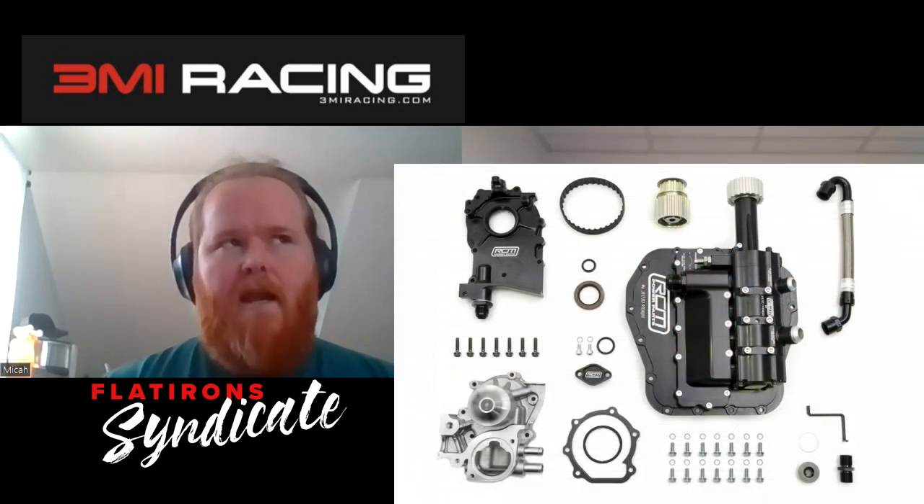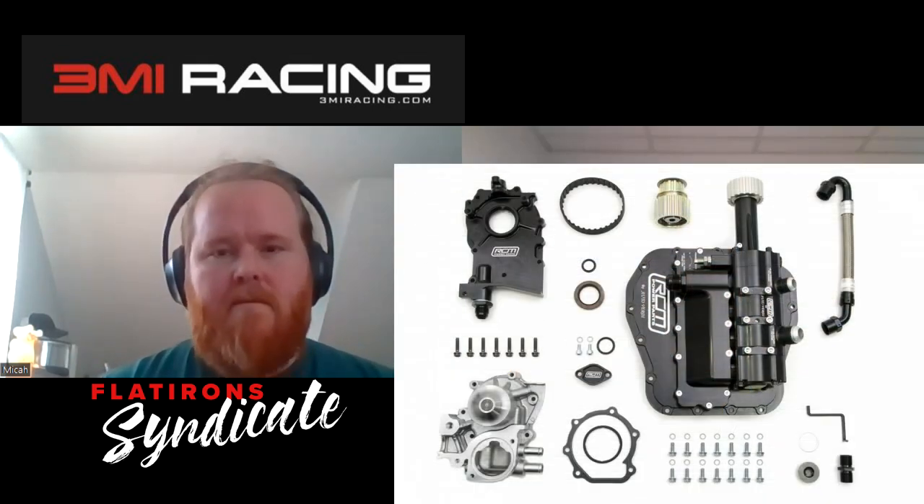I've got a few wet sump bits coming out because I think for most people, buying a dry sump if it's not necessary is a massive expense that I don't think a lot of guys at the Subaru level actually need — so long as they take care of the wet sump system itself. A dry sump system can add power if done properly, but most people don't have the tools necessary to make it advantageous. So basically it's four or five grand, if not more, essentially just for insurance.